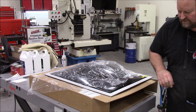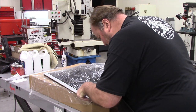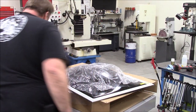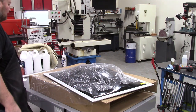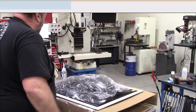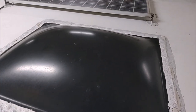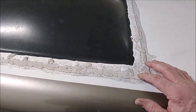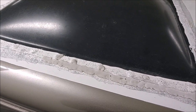Setting the frame on the dome to check alignment — I've got a piece of tape on this corner of the skylight and a piece here as my reference. It's good. It's positioning about a half hole off — just shift it a little bit. Excellent, that's going to fit perfectly. The next order of business is to get the old skylight off and then this one can go on. You can see this is not a bad install by any means on Monaco's part — it has held up well; this is all original.